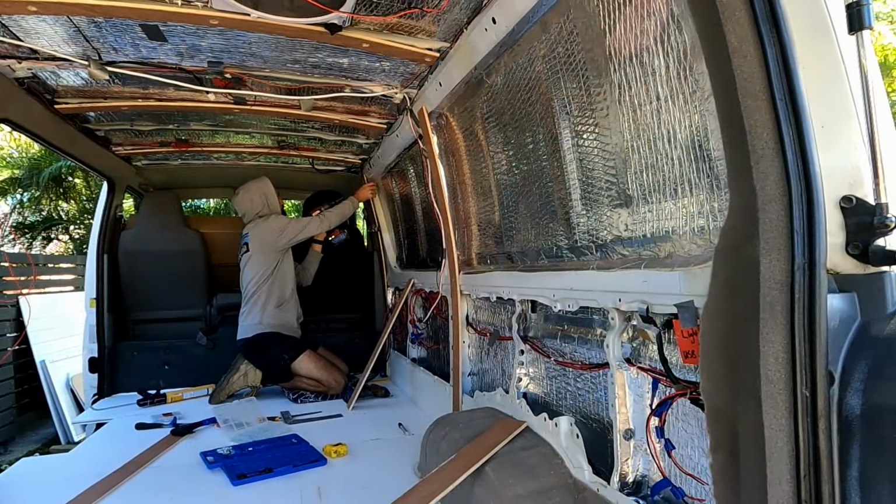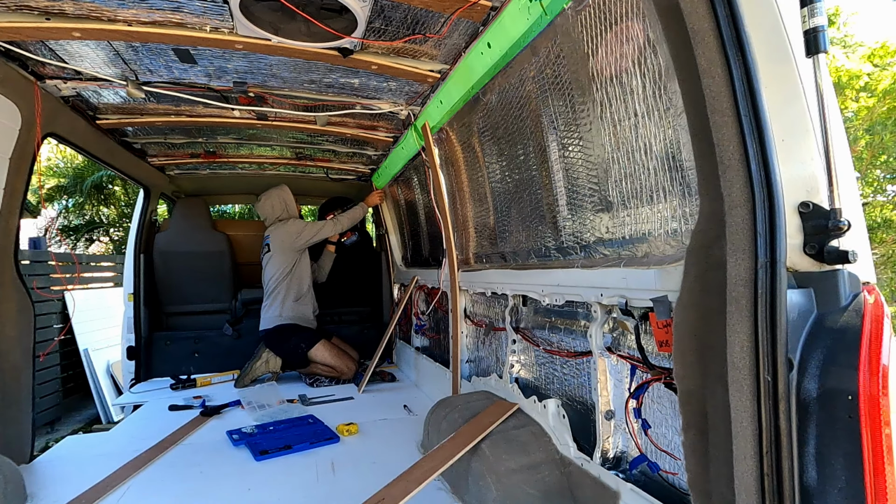What's far more important than the position of the strips along the length of the van is the position of the fixings that you have in each of your strips. A full-length timber strip needs at least 3 points of contact and fixing with the van wall. So you'll find looking at most van walls, there will be some obvious choices for this where there are support rails running the length of the van at the top, the middle, and the bottom as well.